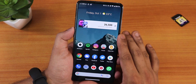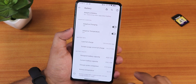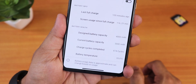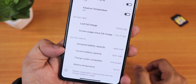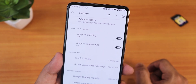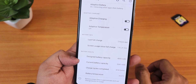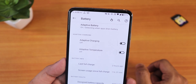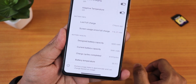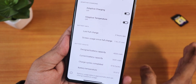When I came home and plugged the device in, it was charging normally and showed about 30% when plugged in — a weird bug. The battery dropping from 20% straight to zero could be because my battery is pretty old. As you can see, it has 614 cycles. The current battery capacity shown is now dynamic — it adjusts based on your battery percentage, unlike earlier Evolution X ROMs which showed the full battery capacity.